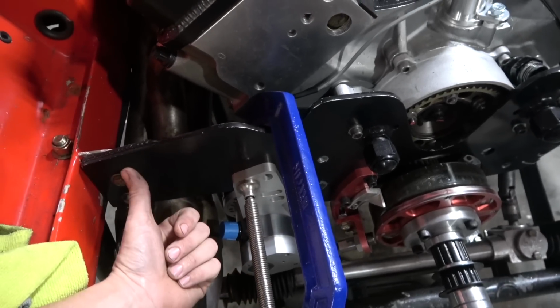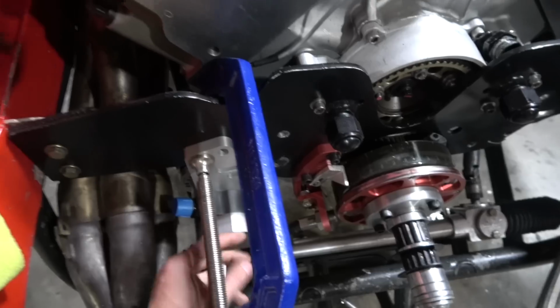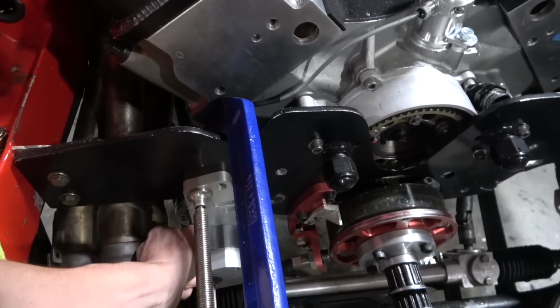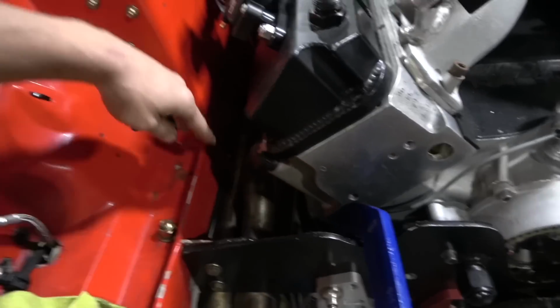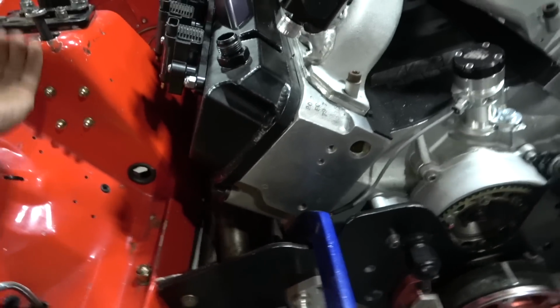This one coming out this way toward the header is not ideal, but if we move the pump to here and then rotate it up a little bit, then we can do a port fitting from Brown and Miller that goes straight in there and then 90. And that's going to go over to our clear view to the motor, and then come out of here, mount the fuel filter system one right here, it goes into that, comes out of that, goes into the rail, bam, go to the racetrack.